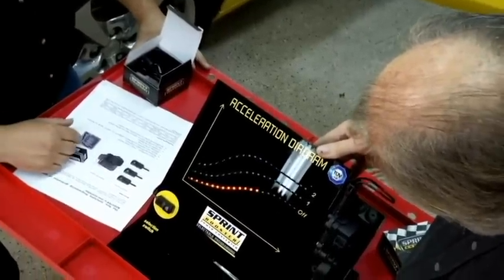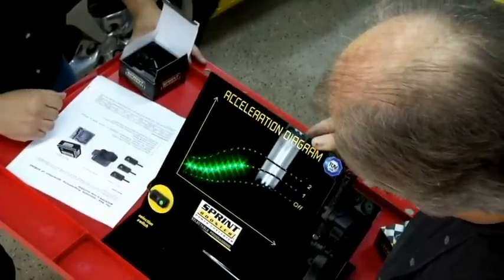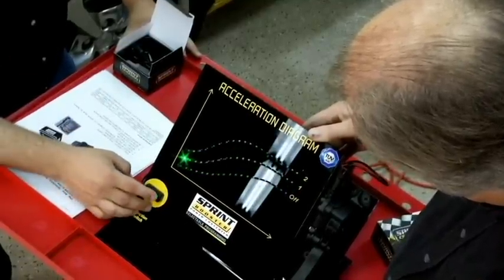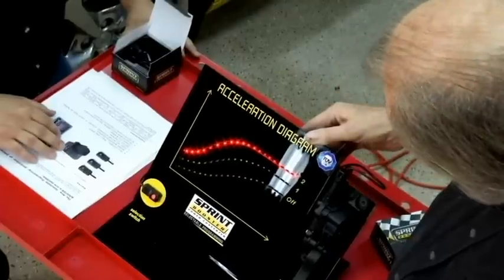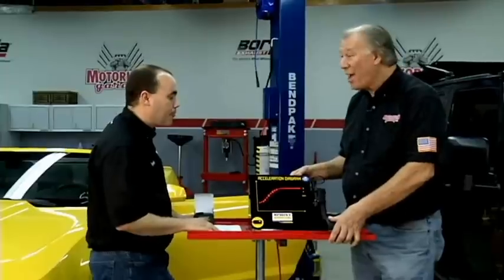It opens it how they programmed it. Look how long it takes to do that when I slam the throttle down. And then we switch it over to stage 1 right here. Okay. Which is still a progressive rate, but it's a lot quicker than what the factory provides you with. Yeah, it sure is. And then stage 2 is where the fun happens. Oh, look at that. That's a linear opening, just like your cable throttle. So just like the old cars, when you push the pedal down, the throttle body opens, and away you go. Push it down, something's going to happen, that's for sure.